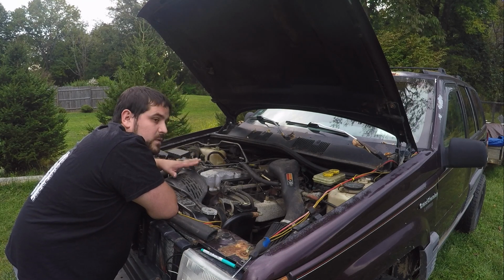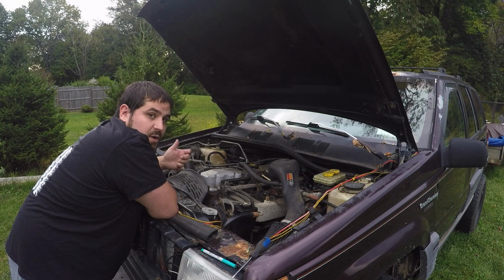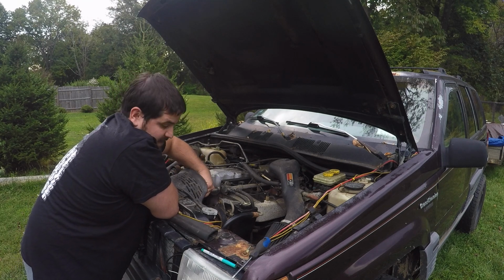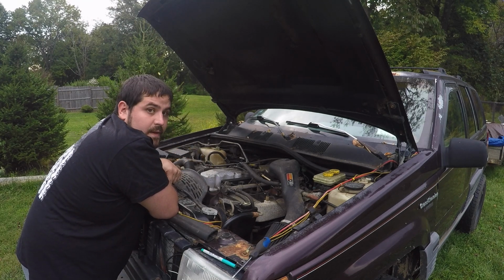That's another area we really didn't talk about, is the fan blades are very important when trying to cool. And you can get upgraded ones. The factory ones work as long as you have a clutch that works. Some people overlook that during overheating problems. It's the clutch that usually is the problem. If you can't figure it out, make sure to pull that blade and make sure you can feel resistance. Also, for the XJ, you can get a towing radiator for that.